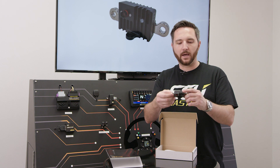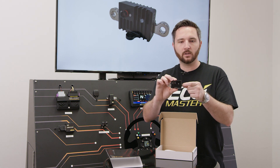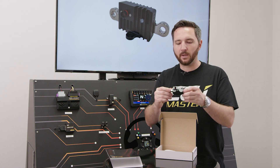This is the normal style that has just battery lugs. This is an 8mm hole — you can use an 8mm bolt and terminal and just throw a boot over it. These are nickel-plated aluminum, so very corrosion-resistant but with very high current capacity.